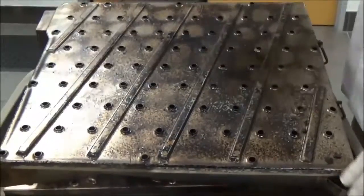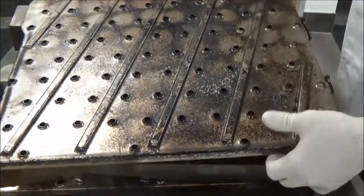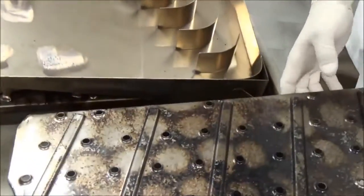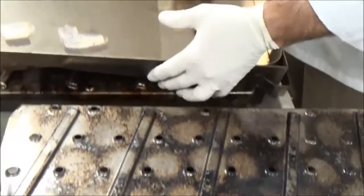We're going to be cleaning all these parts with approved TurboChef oven cleaner. The jet plates — both of them — have a top piece which can be pulled off by lifting on one side by the handle and pushing back. This way you can spray the bottom piece and allow it to set, while the top piece is generally clean and can be used readily.